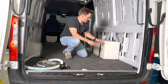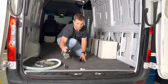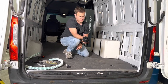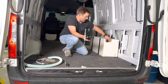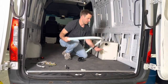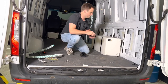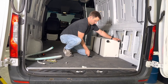We don't sell these fittings, but here are some examples of how you could set this up to fill the tank. You can use a gravity fill port like this — it comes with an inch and a quarter as well as a half inch barb on the back. You can screw in an inch and a half to inch and a quarter barb and use RV hose pushed on. If your cabin is right here you can mount it right about there, and you could also use a 90-degree fitting to position your fill port as needed.